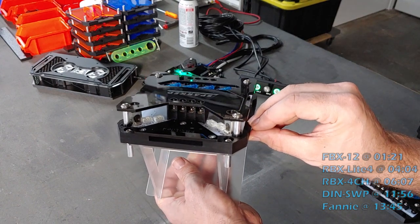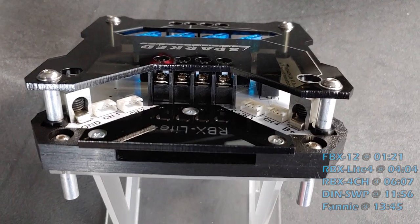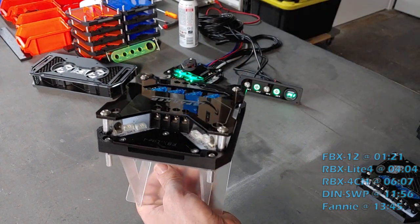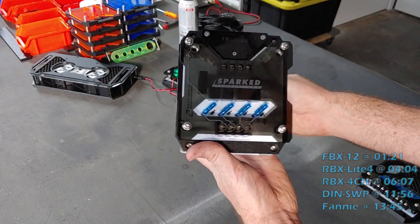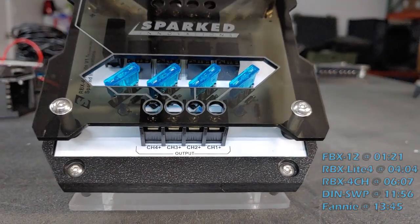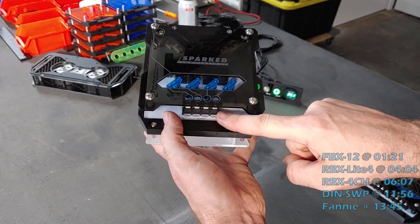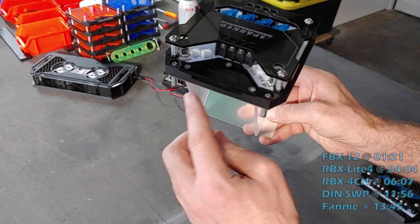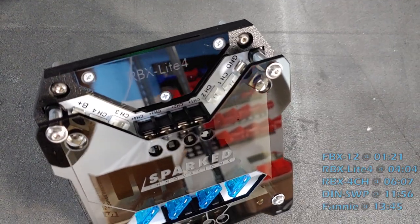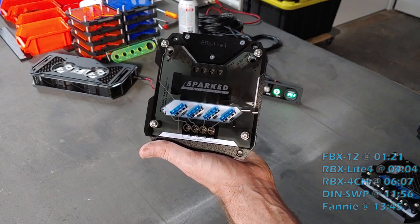The unit is universal and will accept any 12-volt positive trigger via the four spot barrier strip. This is where you can activate any of the channels via ignition or illumination from your vehicle, or your own switch that has a positive output, or even a remote turn-on from a head unit. On the output side, each of the switched channels is fused at 15 amps and we have a four spot barrier strip that allows you to use a fork terminal or any 12 to 26 gauge wire to go to your accessory. It's a simple 12-volt positive switched output from each of these outputs. The unit also features a wire nameplate clamp, and blue LEDs that switch on with each channel to indicate that the channel is activated.